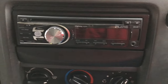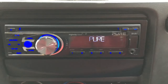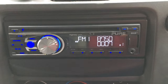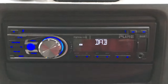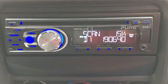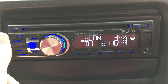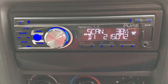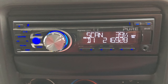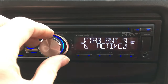Now turn the power on with the ignition — and there we go, it's working as expected. Let's put it into DAB mode to show that the digital radio is working. I also need to change a setting on this head unit because by default it sends power to the antenna out of the aerial socket, whereas my adapter doesn't need that. It's currently doing a scan of the digital radio frequencies. There we go — DAB antenna, change that to passive.